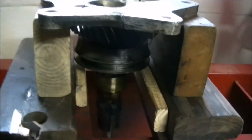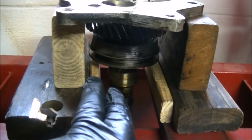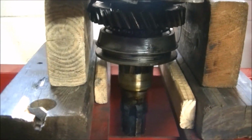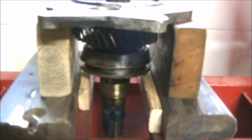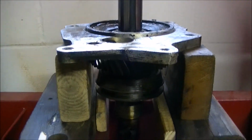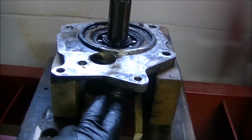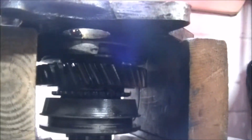I've got the center support up on some 2x4s, and I've also got some small pieces there, and the synchronizer sleeve will hit those pieces to keep this thing from dropping down to the floor, because I don't want this assembly to drop down the floor when it comes out of that adapter. And I can't hold it because I'm going to be using the pliers on the snap ring way up in there. Plus I'll be using the handle to activate the jack.